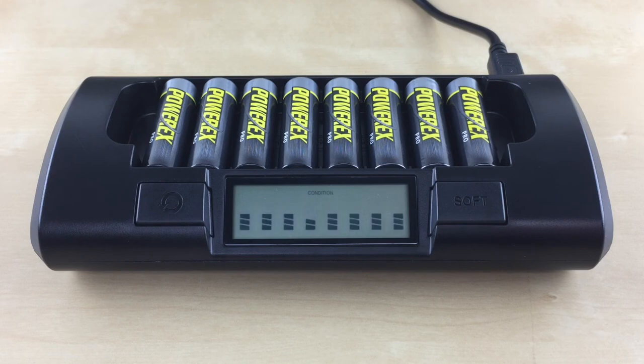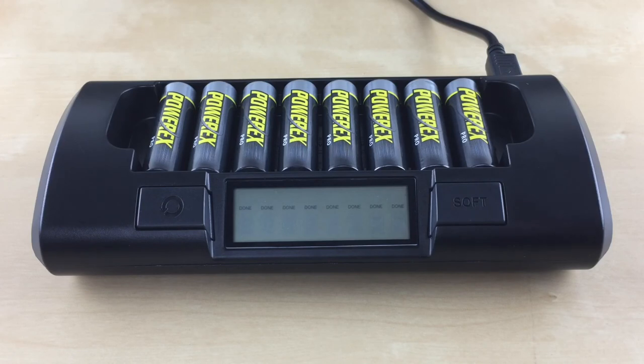If you see the battery outline disappear, leaving the inside part flashing, it indicates the batteries are currently discharging. The charger will display a solid DONE when the batteries are conditioned and fully charged. It is normal for all the battery symbols to disappear from one or more slots towards the end of the discharge step — this indicates that the discharging step is almost done and the recharging step will begin soon. During the discharging step, batteries that finish before the others will show the charge symbol; however, actual charging will not begin until all batteries have finished discharging. It is also normal for the right side of the charger to become warmer during this cycle. The charger will go into standby mode once all the batteries are done conditioning. To completely turn off the charger, just unplug it from the wall.